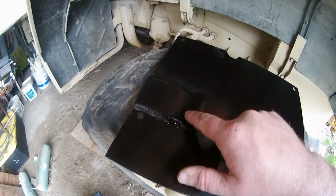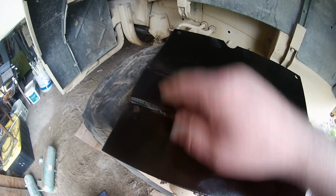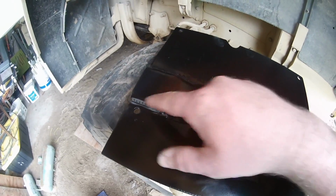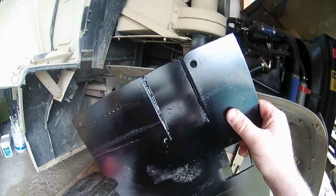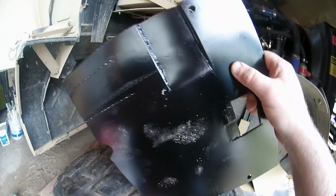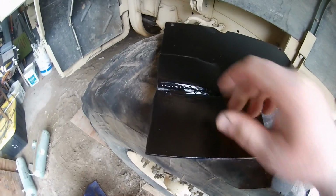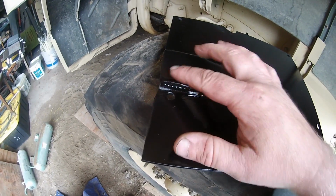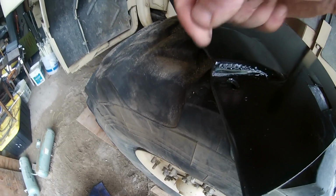So anyways, what I did is I lifted it right here. I just cut it, lifted it up, slid a bar across, and pounded it back down so that I got this little flat. And what is it AVE says? Grinder and paint make me the welder I ain't. But that makes room for that fitting to come off, and it provides this little ramp which is higher than the level of the Fumoto valve lever, which is right here.